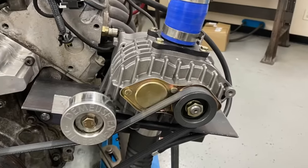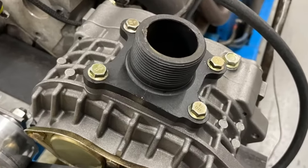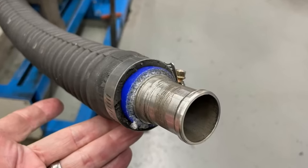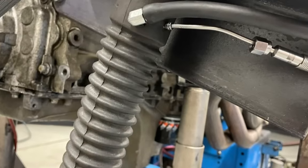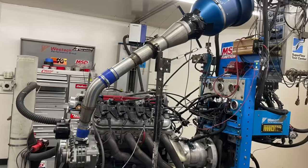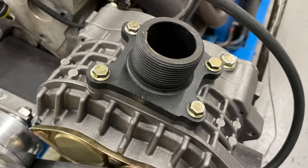After testing the airflow of the AMR500 supercharger with the factory inlet and outlet basically open, so free-flowing, what I did was install a section of tubing with a restrictor on it so that we could produce boost. I then monitored the boost pressure and the charge temperature so we could see how well the AMR500 was actually working.